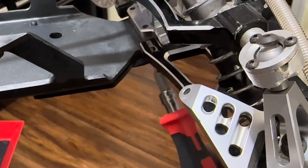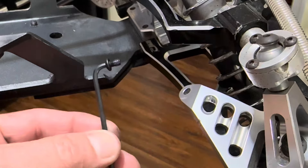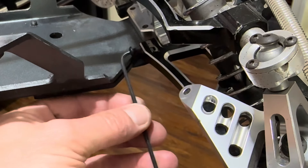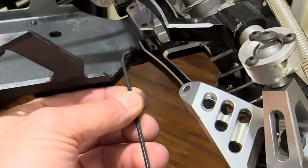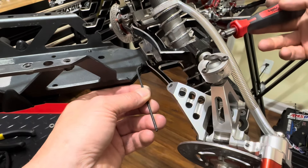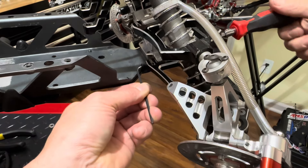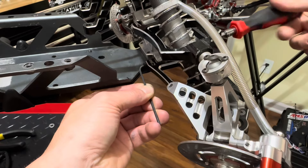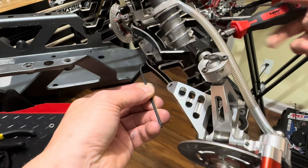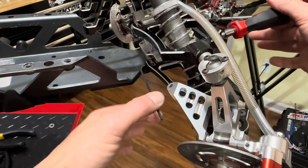For getting up in this area right here, I cut me a little allen key down so I can get up in there for the tightness and the rightness. You can just get on over here, hold it here, and tighten her on up. You don't have to crank these super tight - just turn them to the stop with some Loctite. Done.